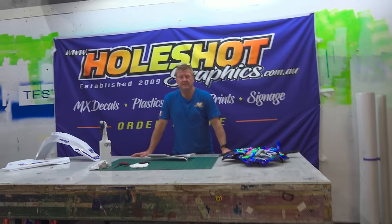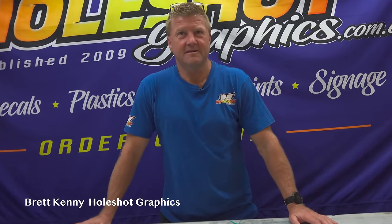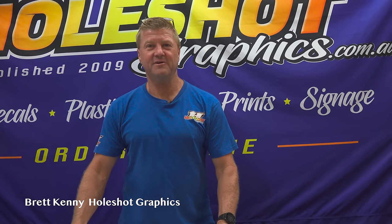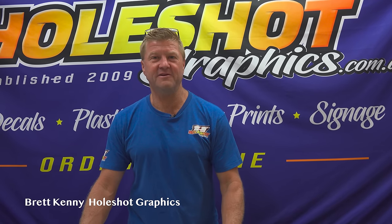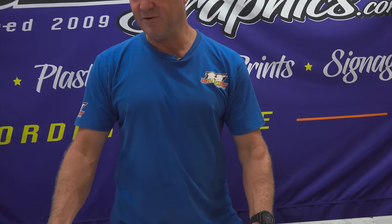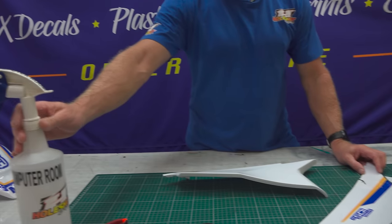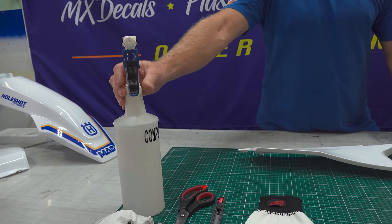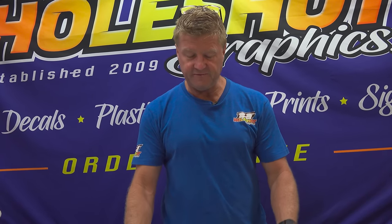I'm with Brett from Holeshot Graphics, and he's going to give us a bit of tuition today on how to get these decals on and to stay on. Hello everybody. A lot of people think it's a dark art to put graphics on. If you just take your time and have the right equipment, you shouldn't have any problems at all. First of all, we have our graphic, our plastic, and the tools we're going to need today: some isopropyl, or you can just use alcohol or metho from Bunnings. That'll take all the impurities off the plastics from manufacture.